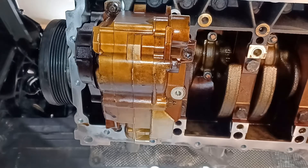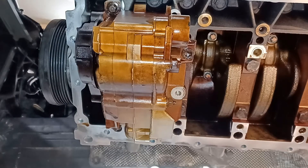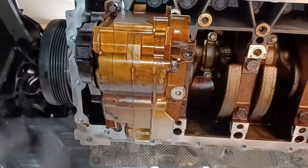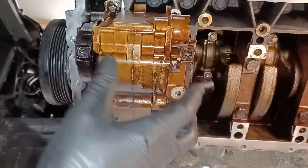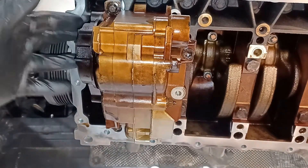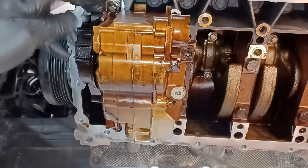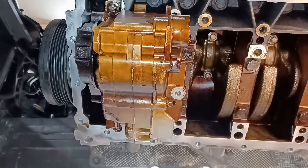The oil pump is now bolted on. It wasn't too difficult actually and contrary to my fear the oil didn't come spewing out all over the place. I torqued the three bolts to 25 Newton meters which is apparently the correct setting. The only thing you have to do is line up the circular dowel holes - I think it's this one down the bottom and this one on the side. Whilst doing that you've got to juggle the oil pump sprocket and guard into place, fitting onto the dowel at the top.